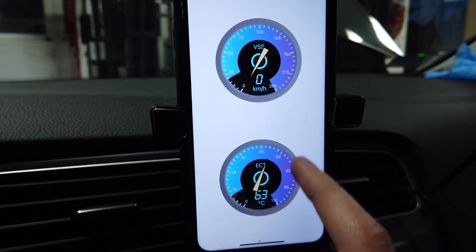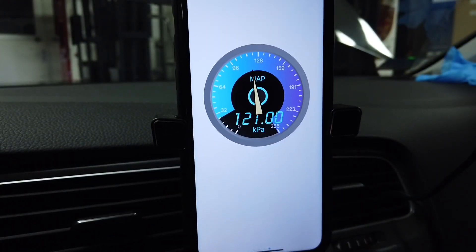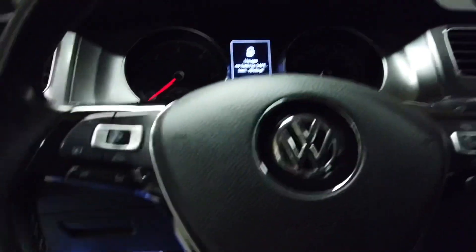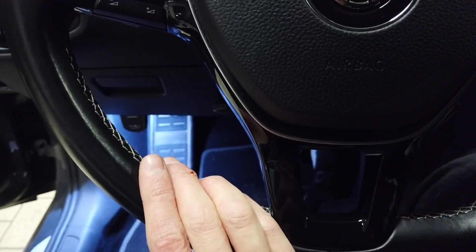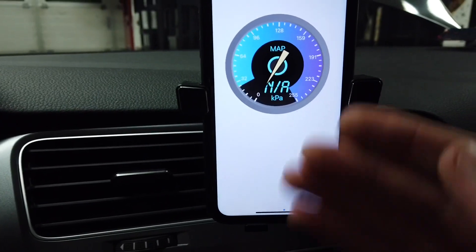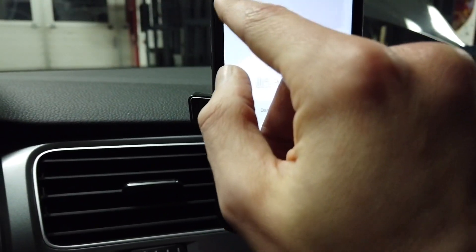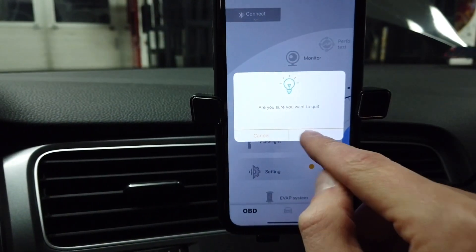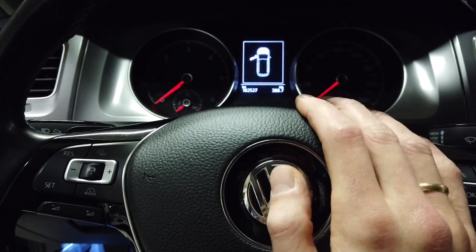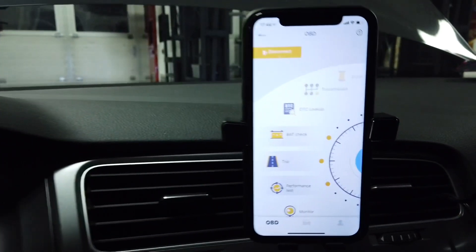You can see it's working and we can monitor values like engine coolant temperature or vehicle speed. There is a little lag in the data transmission, but I believe that's the OBD2 standard — it doesn't provide data quickly enough for a rev counter. The transmission is too slow and there's too much lag to use it as a regular rev counter or shift light, but for data like coolant temperature or exhaust gas temperature it will be just fine.